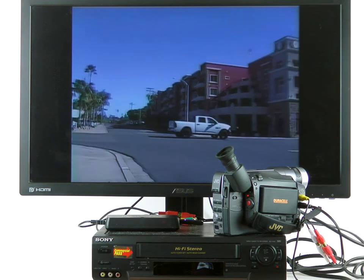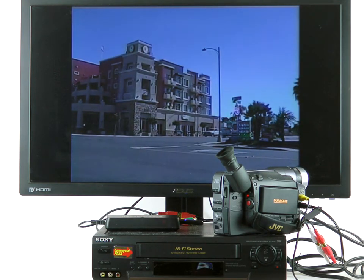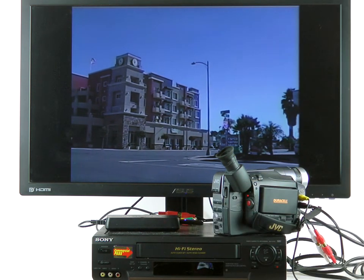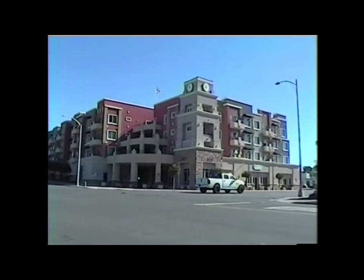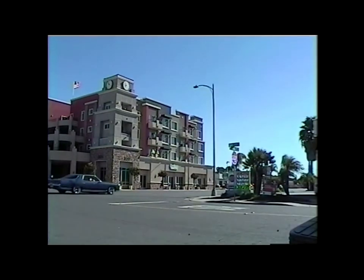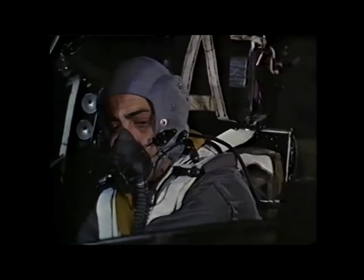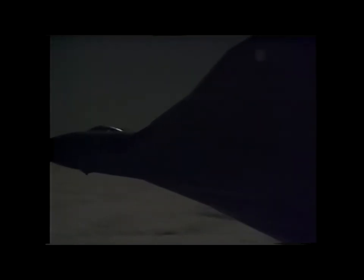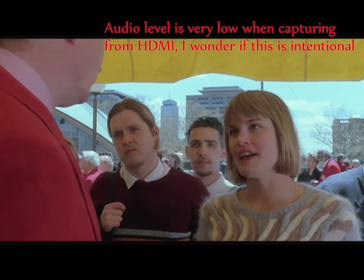The box has three bitrate settings. The highest setting uses 16 Mbps, which is a healthy rate for the AVC codec. Audio is recorded as AAC at 192 kbps. Movement in 1080p video is more jerky because half of the images have been lost. On the other hand, a movie captured into 60p still looks cinematic because no extra frames have been generated.